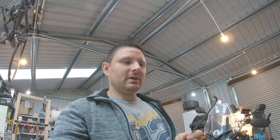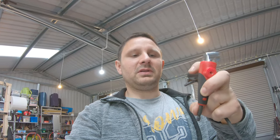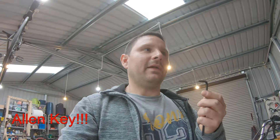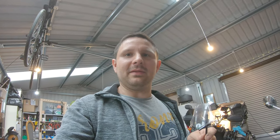So day number 2 with the valve clearance job. I'm going to use a standard, basic tool, because I didn't find something that I could use. This one I tried to use, it's a 90 degree adapter, but as soon as I went a little bit stronger, it broke. There is a little gear in here, and it's ideal because the torque that you apply at the input is what you get at the output, but obviously it's not strong enough, so I cannot use this. So we go with the standard tool, and you will see what I will do when I have to put it back together and apply the right torque.